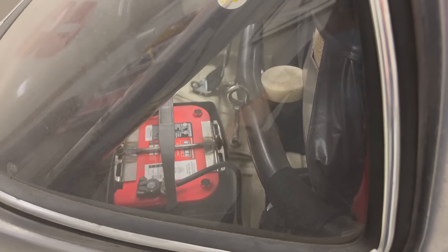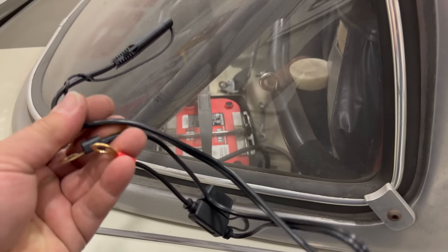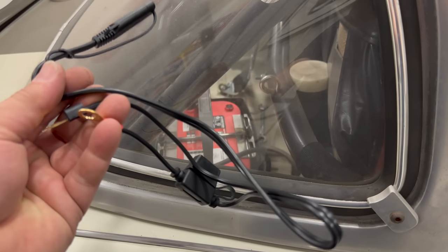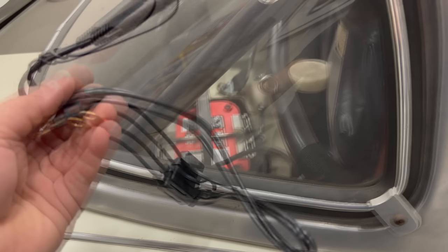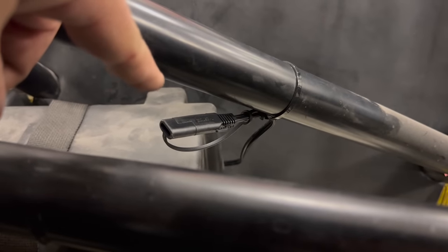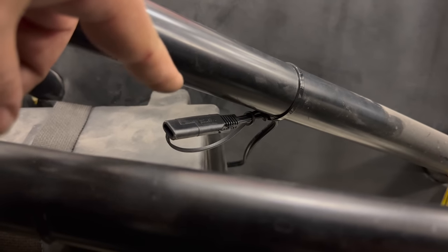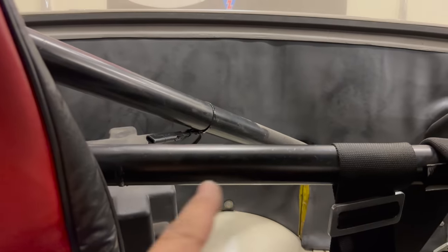The new battery is installed and I don't want it to go bad, so next I'm going to install this connector that has a typical battery charger connector. That way I can easily make sure to keep the battery charged and hopefully not ruin it. I can also charge it up in between races if I want to, and it's just a little more security that I'll be able to finish the race. The battery charger connection is installed. The neat thing about this is I can use it for other things besides just charging the battery — I can put a USB adapter on there, I can put a cigarette outlet adapter on there, and I can even use this to power a camera that I'm going to mount right here.